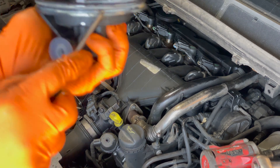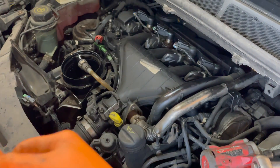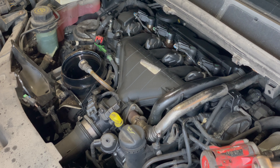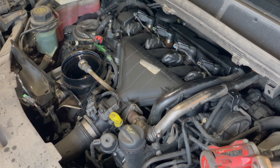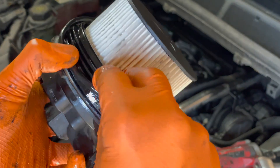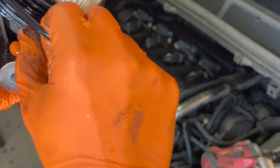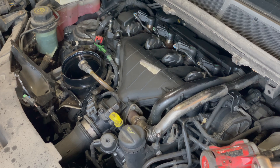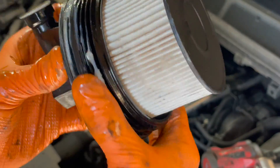The next stage is to change this O-ring. Dispose of the old one. Fit the new O-ring — try not to twist it. I like to put a little bit of silicone grease on; some people disagree with this, but it does help it go in. Just lubricate the new O-ring like so.